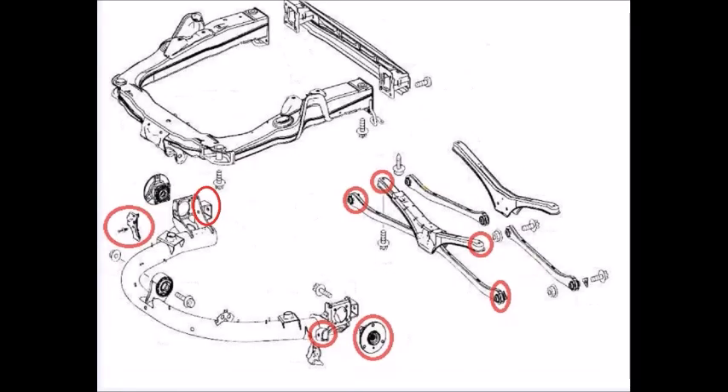This is the suspension of a Smart ForTwo. To remove the drive shaft, undo the wheel hub centre bolt — you don't need to touch the brakes. Just tap the centre bolt after removing the wheel, the plastic cap covering the rear shock absorber bottom bolt, and the X-frame which bolts onto either side. Undo that and you should have enough room to pull the drive shaft out. If you're struggling, loosen the other side and the top bolts that go to the main frame to gain access.